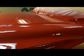So the reason I was throwing that third coat of clear on was there was a couple pieces of trash in this side that I really thought I was going to have to do more sanding on than necessary, so that's why I threw the third coat on it, and that didn't work. So, you know, it happens, and I'm definitely not long-armed enough to get to the middle of that hood. I'm a little peely in the middle, but the rest of it, it turned out pretty decent.